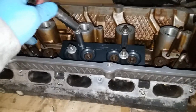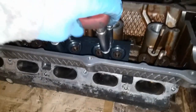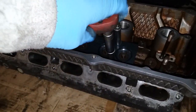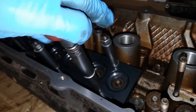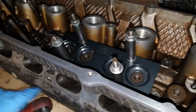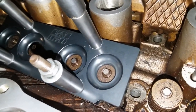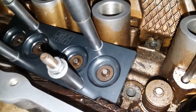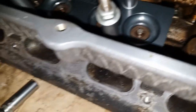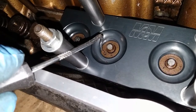Start with the shorter spacers, then move to the bigger ones to begin further compressing. You can see how it's beginning to compress. Sometimes the valves will compress along with the valve spring — that is not what you want. Usually what happens in that case is the valve keepers — these little pieces right in there — will sometimes stick in the retainer and draw the valve down with the retainer.